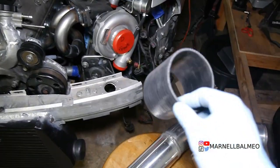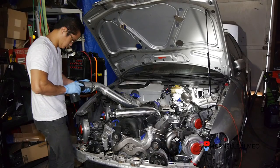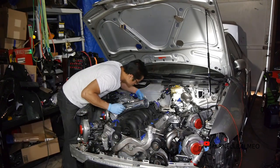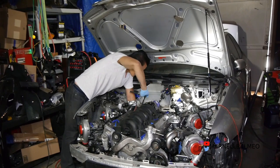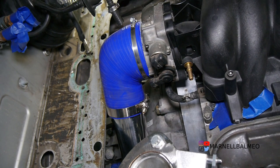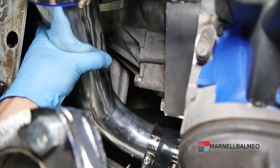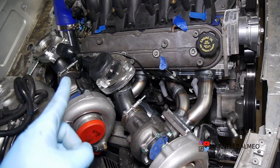We'll need a straight coupler and a 90 for the intercooler. Straight out of the intercooler — a 90, then a 45, another 45, then a 90, and finally another 90 coupler. It's pretty straightforward: straight from the intercooler and up. Clearance-wise there's plenty of room. I'm planning to add some sort of bracket from here to the block to solidify it — I can't do a bracket on both the back and front because the engine is mounted separately from the bumper.